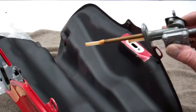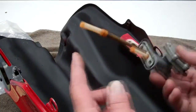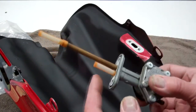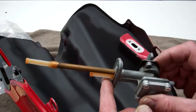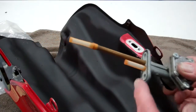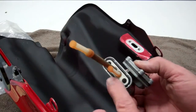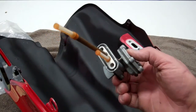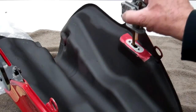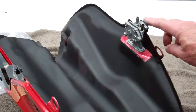Next we're going to put the fuel petcock back in the bike. Make sure that this is super clean and that these little screens have no even tiny little holes in them, because you need it to filter the fuel really well. Otherwise you'll get crud in your carburetor and have problems. Make sure the O-ring is in good shape with no cracks. Then go ahead and insert it into the tank. Be kind of careful, with the valve to the outside.